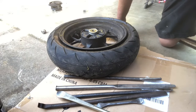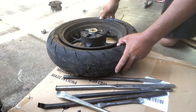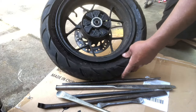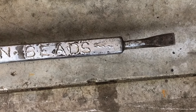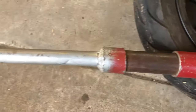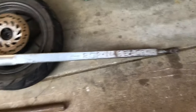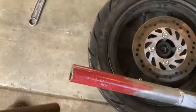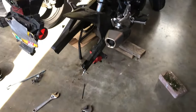Quick video — if you've never changed a motorcycle tire before, don't let it intimidate you. Tubeless tires are actually easier to change than a tube tire. This tool is called a bead popper; I welded it myself with an end of an old crowbar, a square-to-round fitting, and a solid shaft. It's like a slide hammer meant to pop the bead off. We're doing a Grom tire today.